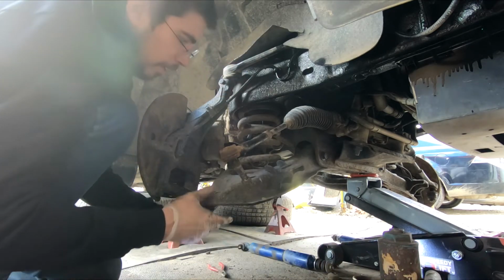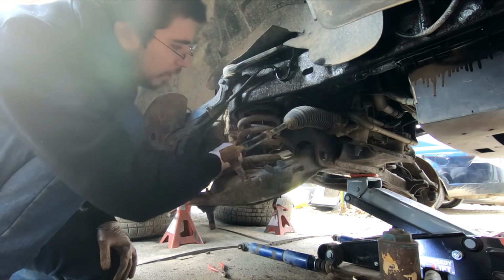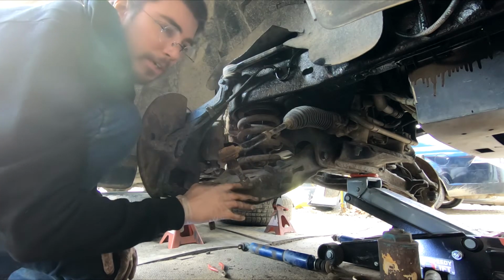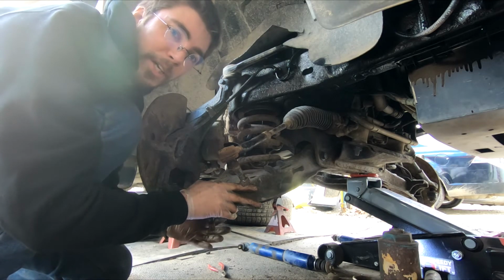This jack comes out, and as you can see, the coil is now held in place by the coil hooks that are right up here so that you don't have this kicking out at you. It's much safer to do. It's worth renting the tool at AutoZone. Like I said, I'll include the information for that also.